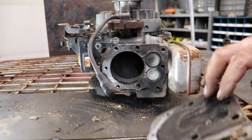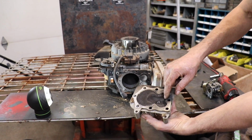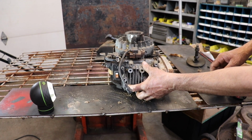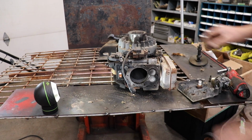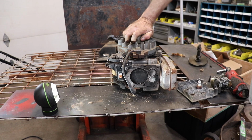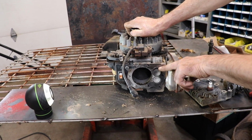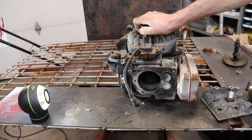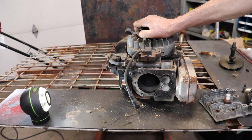And this is the combustion chamber. We have the head off. This area here. See how that is? And there's the spark plug. So that's our first stroke. Air and gas coming in. Piston going down. Intake valve is opening. It's depositing the air and gas mix in the combustion chamber. And then now we go to our second stroke.